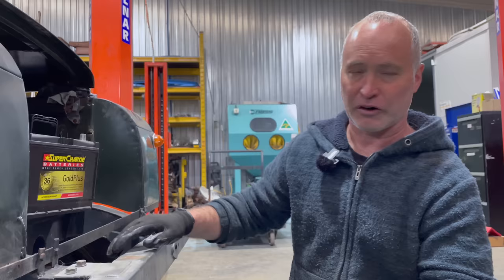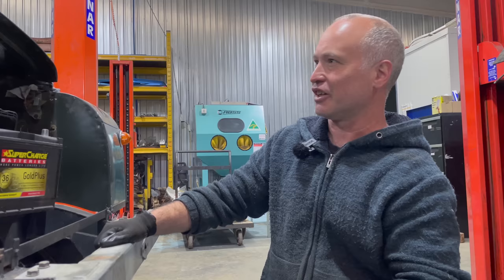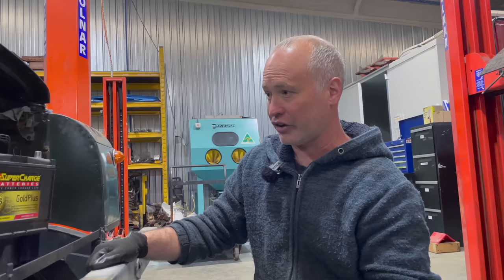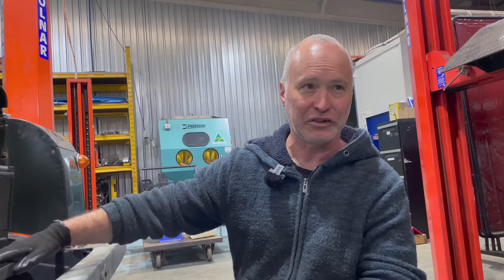And if you're looking at it and you want it to present well, if this thing's off-centre — yeah, I can imagine, certainly on the rutted roads out back. Oh, it would drive you crazy. Absolutely — they're noisy enough. In fact, if you drive one of the electric vehicle conversions, such as the ones made by Jaunt here in Melbourne, for a gearbox rebuilder such as myself it's quite ominous, because it's very quiet without the engine. All you can hear is the whine of the gearbox in the transfer case. You think something's terribly wrong. But no — it's just usually being masked by that rattle of the engine.